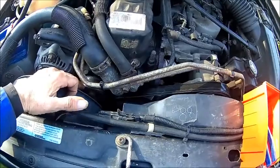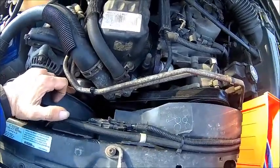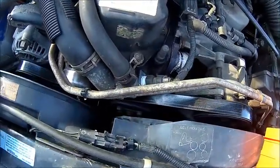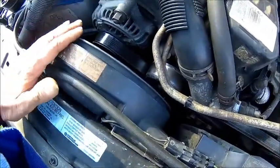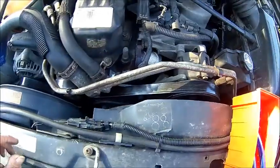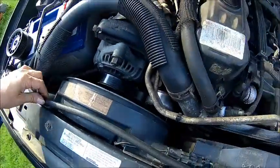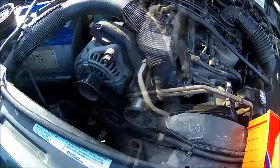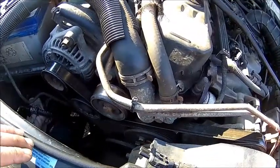And also this pulley is grinding. You can see it walked its way in. That kills the belt as well. So for easy access, just take the second electric fan out. This is the stock fan. This is my visco fan replacement. To get the fan out, one screw here, one screw here. Take the hose away, pull the plug, take the fan out. That's what we do now. Well, you don't need to take the fan out when you've got slim fingers, but I don't.